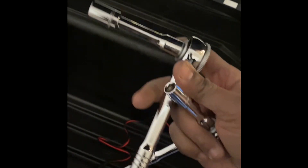I went and plugged this in to make sure it plugs into my battery tender down there. I'm getting one red light, indicating that it is charging. So I'm going to put everything back together. I put the plastic case back in but before I put it in I made a small hole so I could run the charger cable through. For socket sizes: I used a 13-millimeter socket for the rear and an 8-millimeter socket for the two up front.